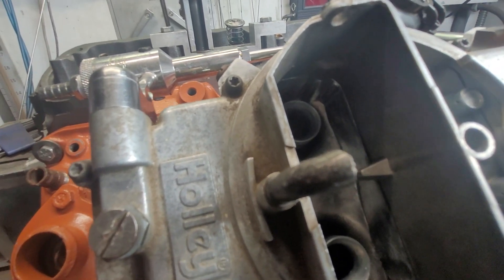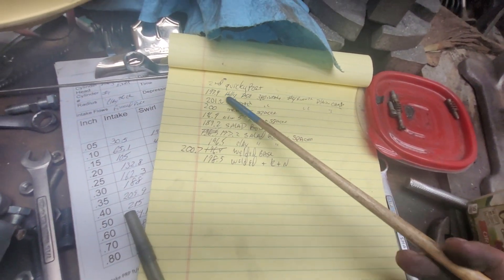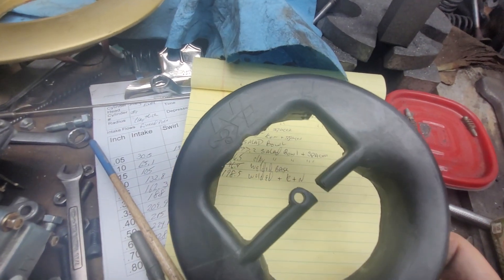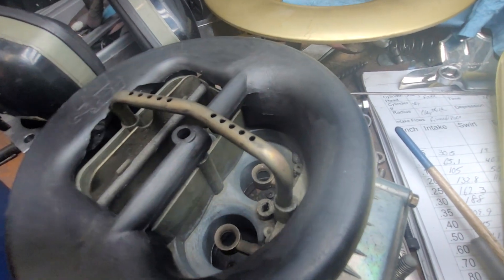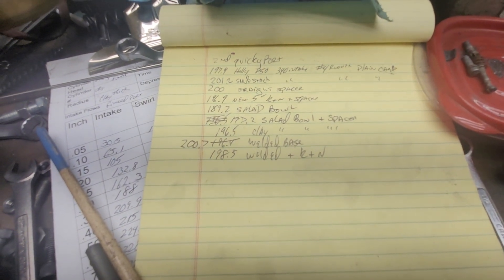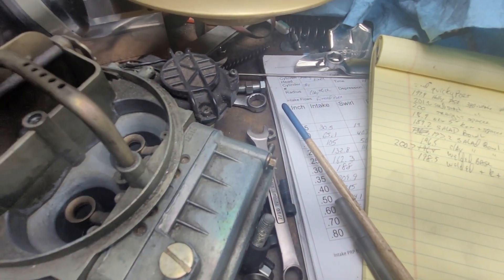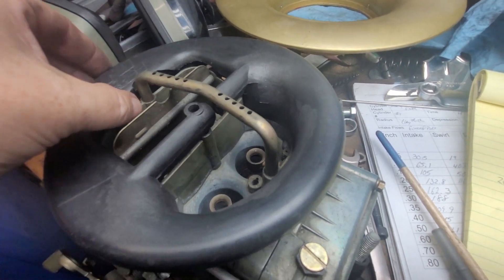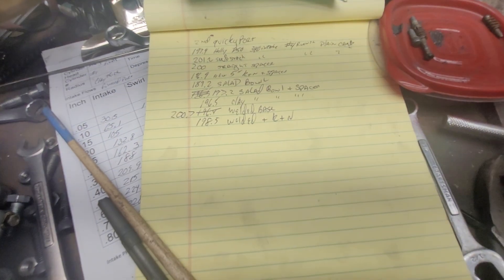Two shorties tonight because the phone acted up, but it was kind of cool. Snubstack — right? Something simple, you can still get these. This has been modified — this is my 770 Truck Avenger. It had to get notched out to go around the tubes and stuff. I wasn't thrilled about doing it. I'm pretty sure it was given to me by someone who said it didn't work. I kind of like the idea of not cutting all the choke horn off — that's what it's designed to do. Instead of cutting off the choke horn, you put your snubstack on and it's supposed to have a nice radius that goes in. I don't know why I had pieces of this removed — I may have had this on a fuel injection at one point. Stuff that's been sitting around for ages.